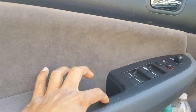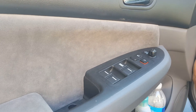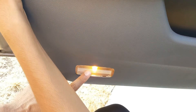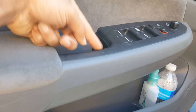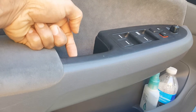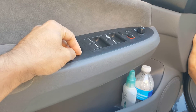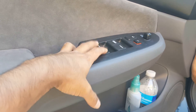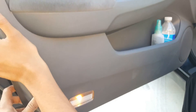One other thing that can be done at this point is to remove this so that you can unhook the wire connectors behind here, and there's a light connector that will be behind here as well. If you do want to take that off, you basically start prying this bezel off from this corner and work your way up. The switches will come along with it and then you can unhook the wires.